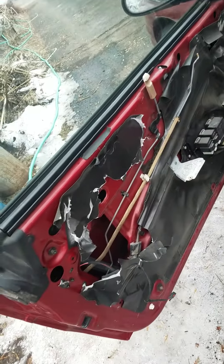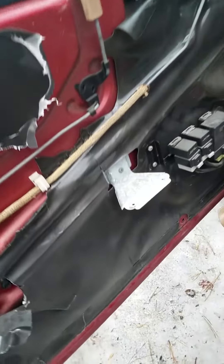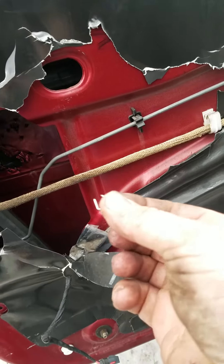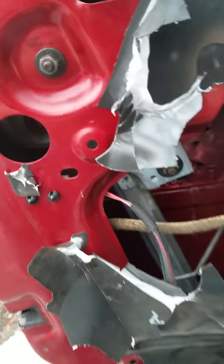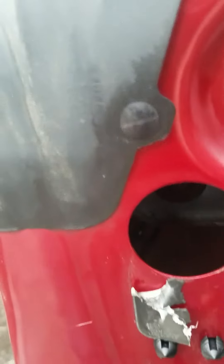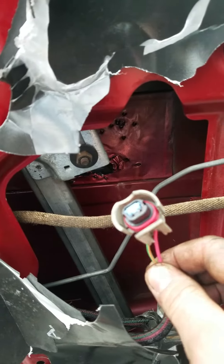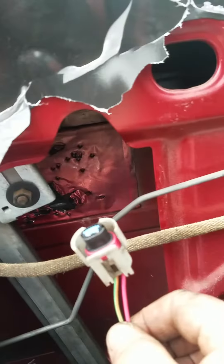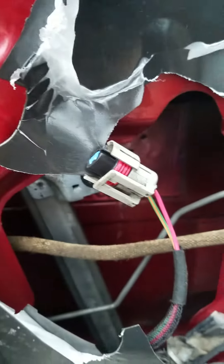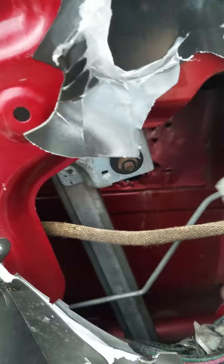I have removed the inner door panel, tested a lot of things, and what I found out — the quick way around this is to take a bent staple to disconnect the wire that connects to the electronic door latch that verifies the key has been put in the lock and turned. I simply insert the bent staple and close the two contacts in this door circuit.